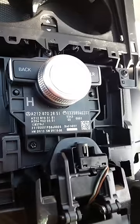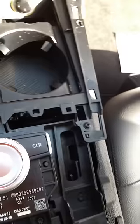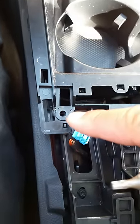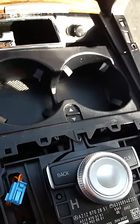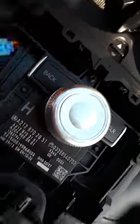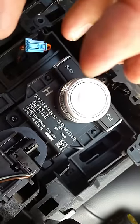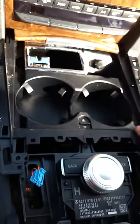Now you have full access to your thousand-dollar control knob that you can buy for $200. To get this control knob out you'll need to remove four screws — there's one here, one here, and identically on this side. You need to lift up the very front of this cup holder to access the screw down there. Remove those screws and this control knob will pop out. There is one wire harness underneath — unplug it, and voilà, you've saved yourself $800. If you have a problem where you need to repair the cup holder, it's a different procedure.